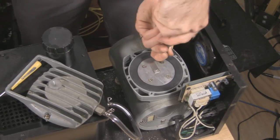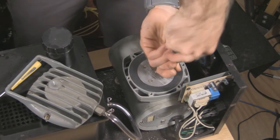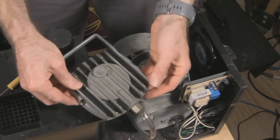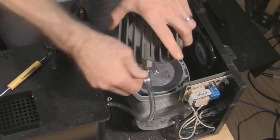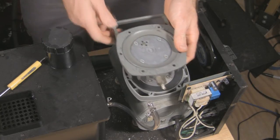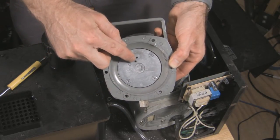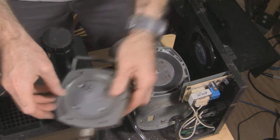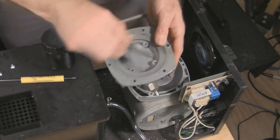Snug these screws down — just remember how tight they were when you pulled them out. Now grab the top of the compressor, take the six loose screws out, and put them somewhere safe because we're going to flip it over. For ease of doing this next step, I'm going to remove the air hose from here — it's a little difficult to do without pliers. Now flip over the top of the compressor. You'll see there's four screws in here and there's a little rubber dimple coming out. This is part of the piece we're going to replace, so remove these four screws.